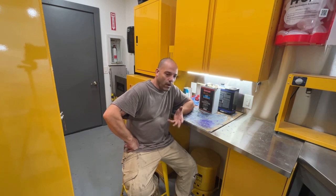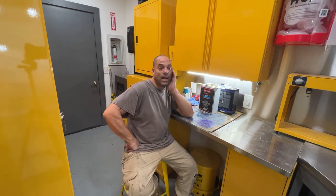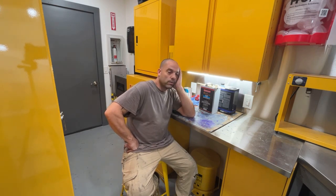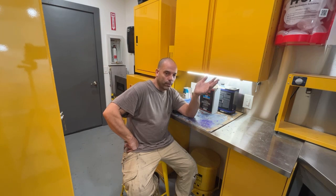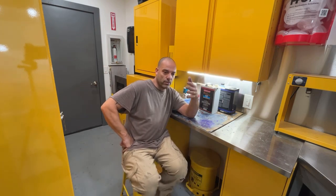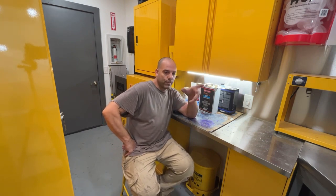If you're doing a car and you want a nice job, take it apart. Take your suspension apart, get it sandblasted, pull your motor out, clean everything up nicely. You don't necessarily have to take off the frame. It probably wouldn't be a bad idea to put new body mounts on the car, but you could still put the body mounts on with the frame on the car by simply doing one side at a time and jacking the body up enough to get it in there.